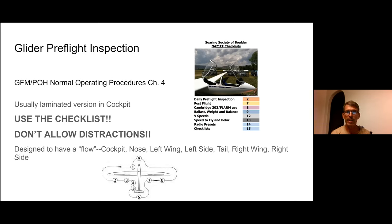So flight control surfaces, if your elevator were to have issues of binding or reduced movement, again, this is not something I have any personal experience with or talked to anybody about, but the handbook talks about using bank and yaw control to help. If you were pitching up, the more bank you put in, of course, you need more pitch to maintain level flight. So if you had some kind of uncommanded pitch up, then rolling into some bank would tend to keep the nose down. And again, maybe using some rudder to help with that. If you're still on tow and able to control the aircraft at all, maybe try to have a tow up to a height where you can bail out.